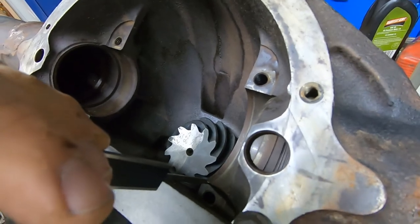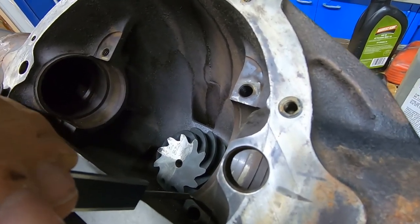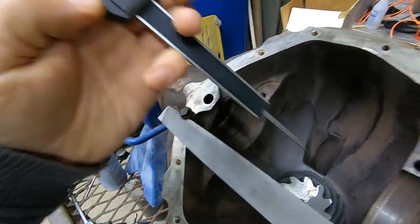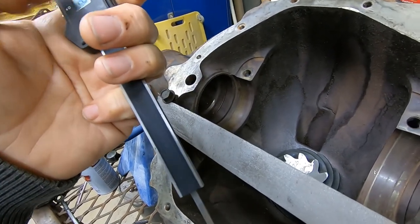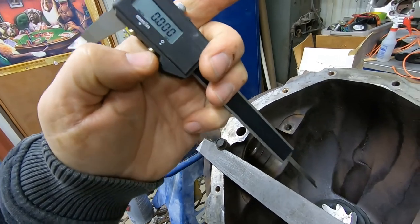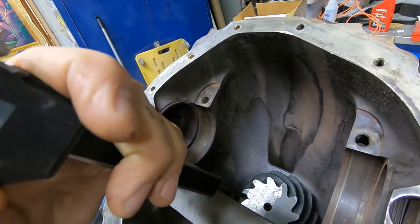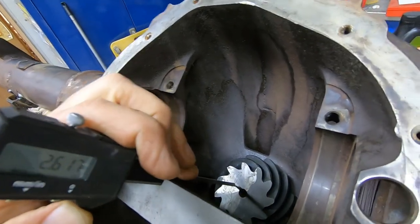And I'm filming this now, but I spent a bunch of time measuring, trying to get the same exact measurement. So there's my measurement there. I could go ahead and measure that overall depth and then subtract this from it. I'm going to use this handy little zero feature on my caliper. Zero that thing out, set this up here, and we're going to go down. We're going to measure that surface.